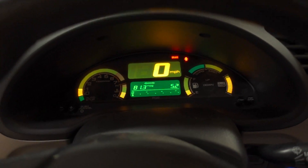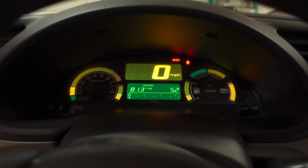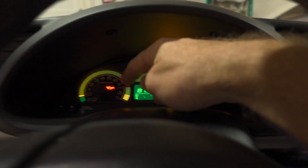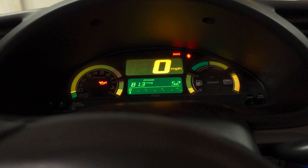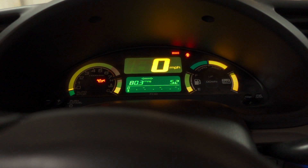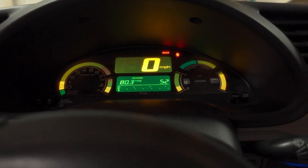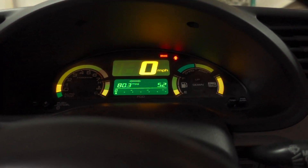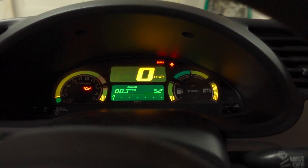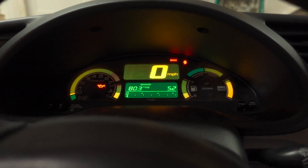Car's starting, and what I wanted to show you — I'm going to go into manual mode here. So there, I'm regenning, but notice the only light that I get is the oil light. I don't get a check engine light. I was under the impression that there was a check engine light related to this. I'm not actually doing the IMA start — there's actually a specific command to do that — and I'm also not doing the IMA stop. I'm literally just regenning until the engine turns off, and I'm not getting any check engine lights.